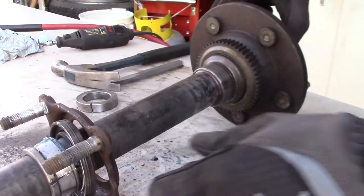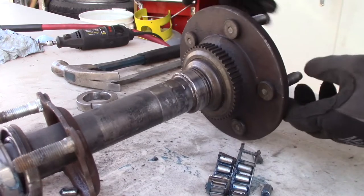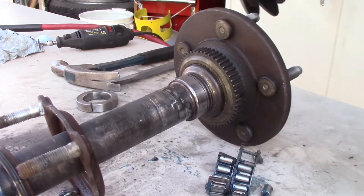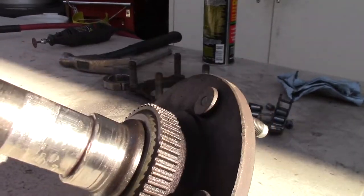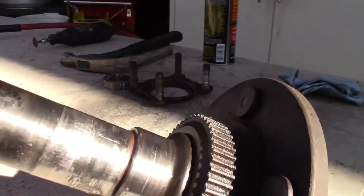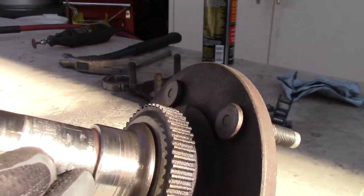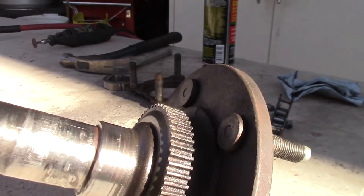And the last guy before me did a lot of damage there. Damaged the sealing surface there too. There's some damage right there on the sealing lip area. And so this is gonna require a Speedi-Sleeve. Look at what the last guy did to this thing. Look at all that damage. That damage on the sealing surface will make it leak. That's going to be a leak that will not seal. You'd have to smooth that out or put a Speedi-Sleeve on it. But if you go too small in diameter, then your seal won't seal.